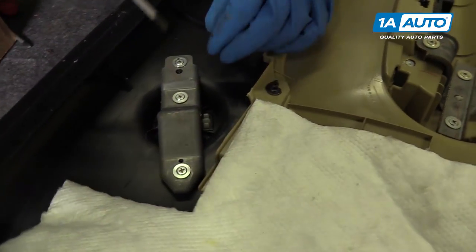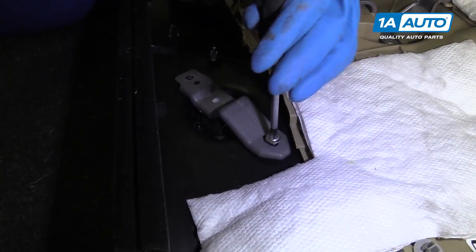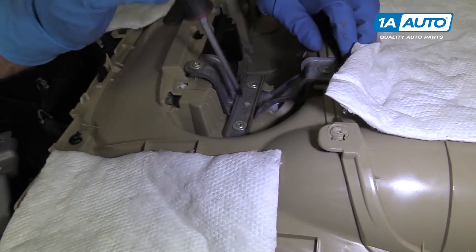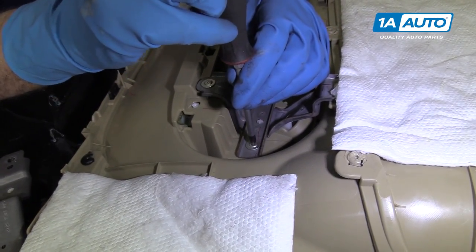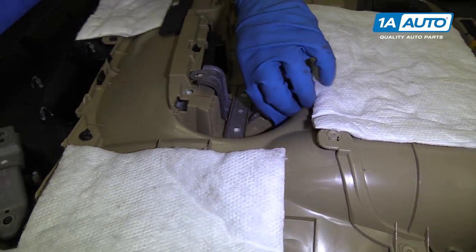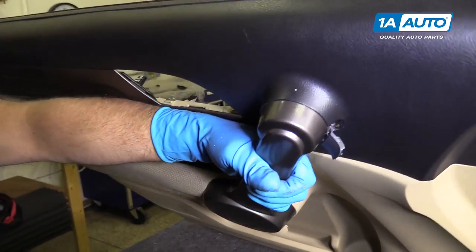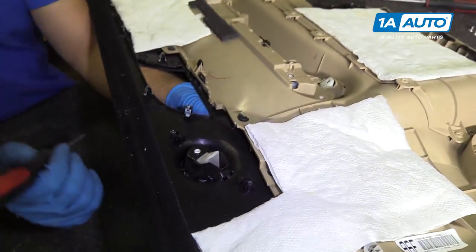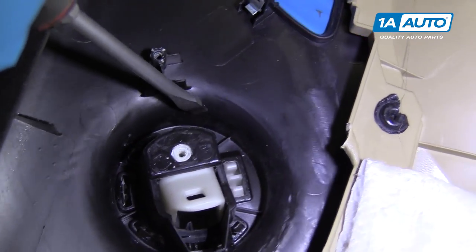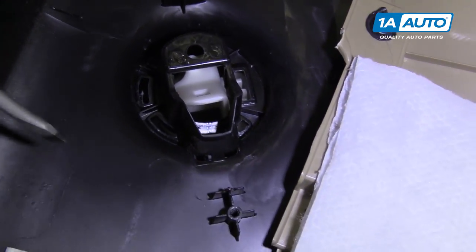These screws out for this bracket. Just use a Phillips head screwdriver. And we'll take these 4 screws out for this bracket. And then pull this bracket off as well. I'm gonna hold this handle with this hand while I'm gonna be pushing it down. While I get in here with a straight head screwdriver, I'm gonna push all these tabs down, pull this handle through,